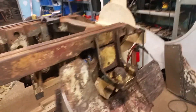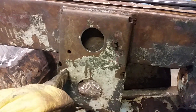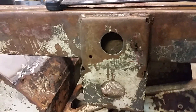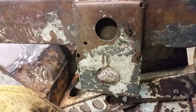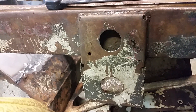I had a good weekend but I'm back at work, going around making sure everything's as it should be. I think I discovered a new type of sedimentary rock - these are the engine mounts upside down. There's a hollow space with holes on the bottom to let water drain out, but mine were packed full of dirt and rocks that had hardened to almost a cement-like consistency. Both sides took a lot of digging with screwdrivers and dental picks, but it's clean now.